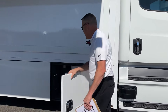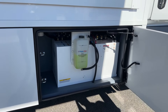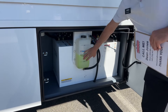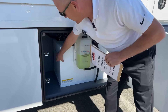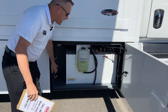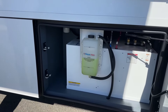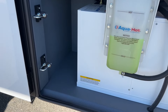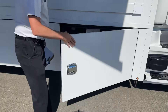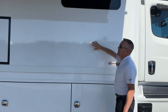Coming down the side here, we do have the biggest Aqua Hot — the 600D — that's going to heat your coach inside and also give you unlimited hot water. It's a glycol system; this is where you fill your glycol. One thing about Renegade is we have a dual-latch door and rhino-lined interior cargo bays — those are going to be durable and last you a very long time. The Classic is one of the only coaches I know of that has an FRP body — you can see the burlap grain to it — it's not your typical fiberglass.